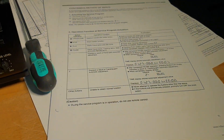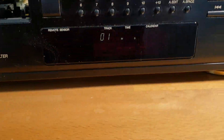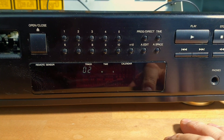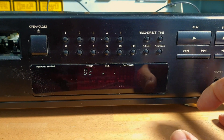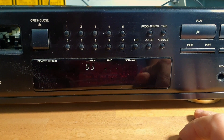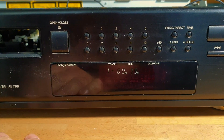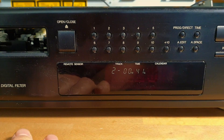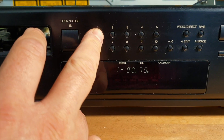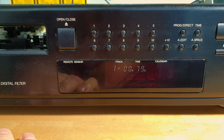And here comes the moment of truth. This is the first power-up and I'm doing it in long testing mode, so we will see if that error remains or not. Let's slowly put it through stages 1, 2, 3, and then calibrate the focus again. Voilà — no error! We see the calibrated gain value on the screen and the tracking gain value is correct. So it was definitely going to be a good player.